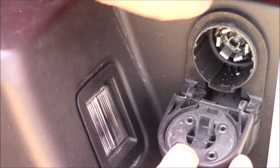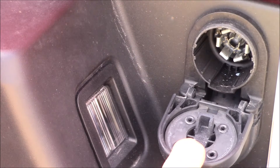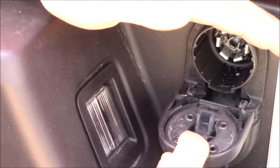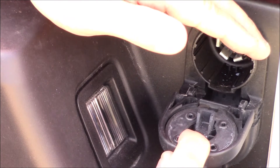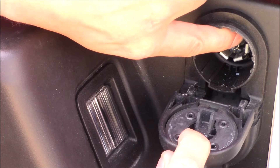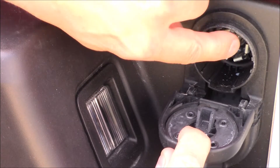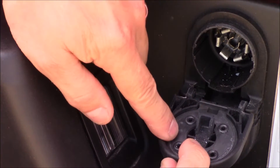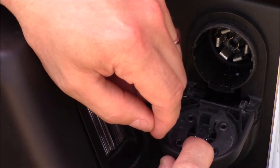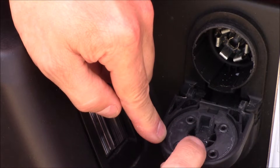What we have here today is I want to hook up some power to charge the batteries on the travel trailer. I had put an aftermarket brake controller on here and it was not activated in the computer. If you take a voltmeter and put it across these two terminals here — at the one o'clock and seven o'clock position — even with the engine running there is no voltage going there, and that's what would charge your batteries on your travel trailer.